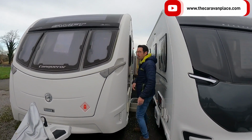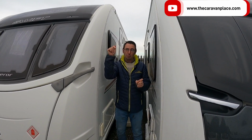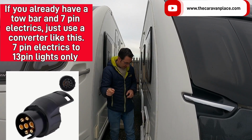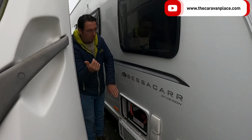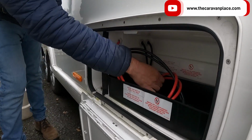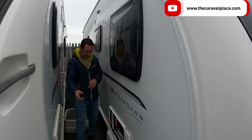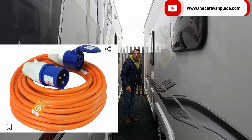And you can always find what's it, can't you? Converter, yeah, so we'll put some little links up, or in the description we'll have some converters that will go from 13 to 7-pin. On the side, majority on the opposite side to the door side are going to have your battery box. This is where you're going to connect up a leisure battery, and this is going to take roughly a 100 amp leisure battery. Mains electric is going to plug into here. You need a special lead for that.